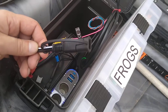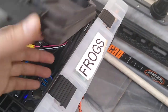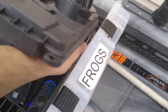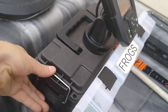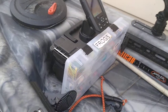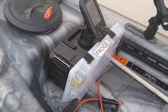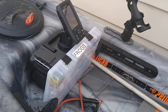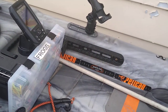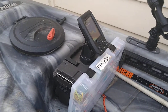So when I take it in, I just hook it up to the charger and walk away. The beauty with these little batteries is you don't have to worry much. If you've got a nice charger for your car or truck, that's awesome, but with a little battery like that, it doesn't take long — even with something that puts out like 1 amp charge rate. Stick it in overnight and it's charged. Trickle chargers are great for that.